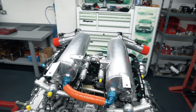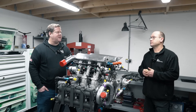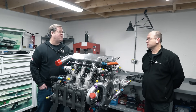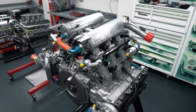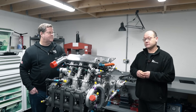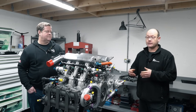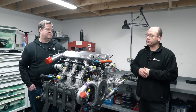One of the things with early Group C engine stuff is that they're doing sprint races now rather than full endurance - the races are actually a little bit shorter. The power level is actually going up. Some of these current Group C spec engines are making way more power than they did before. In period, the Group C regulations were fuel formulas - you were given a set amount of fuel to complete a set number of hours racing. Whereas now they generally do a 40-45 minute race with around 90 litres, which is enough to run them at quite a lot more boost, especially the turbo cars. Porsche engines can run up to 800 horsepower, whereas in period for a thousand kilometre or 24-hour race they may have been run at below 600 to get through the fuel.